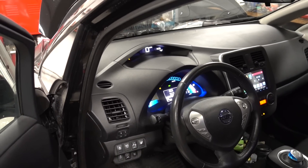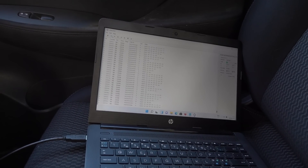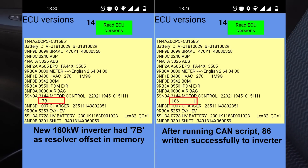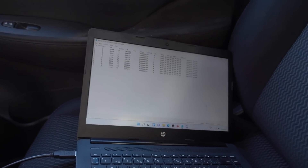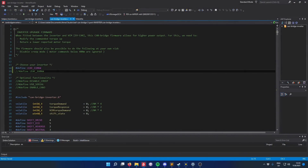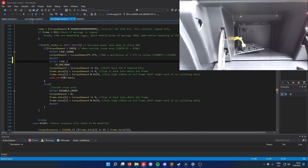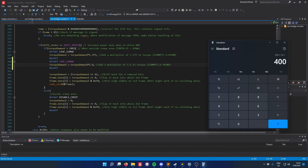Before I drive this thing, I run the inverter resolver offset coding. Here's a LeafSpy screenshot of the before and after — LeafSpy still hasn't been updated to include this coding, so I just run it like in the previous video with a script from my laptop. I'll leave a link in the description for a GitHub repository for how to do the coding in case you want to do this before LeafSpy gets the update. I also updated the code that runs on the CAN bridge that sits between the inverter and the VCM — I upped the demand messages with a 1.6 times multiplier so that we can get the full range of power from the new inverter. This code is available for free on the GitHub as well.